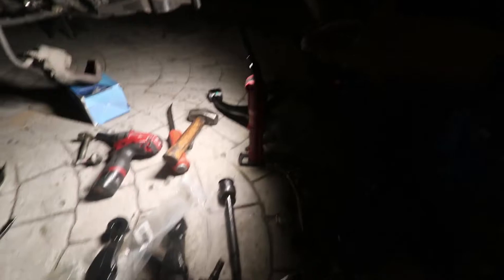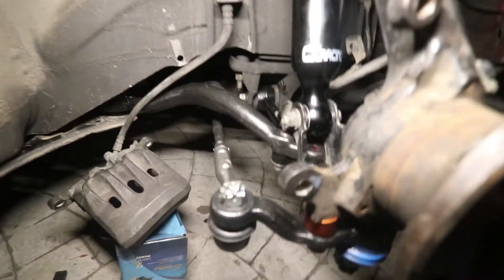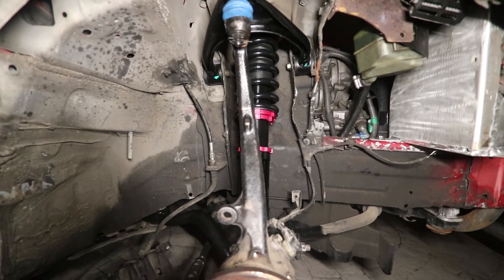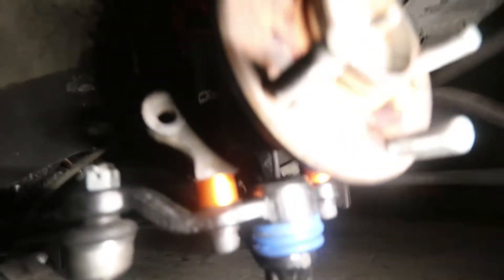As you guys can see, everything is out on this side. I've got the new control arm here, getting rid of the old one, and new arms and new coilover going back in - really excited. We got to get moving, it's already dark out. I've been hard at work and we've got everything installed on this side - coilovers in, control arms, tie rods, everything is new on this side. The only other thing I didn't do is the end links. The knuckle spindle I'm not sure if it's slightly bent, so we might replace that, but upper control arm, ball joint, inner and outer tie rod, and spacers are all done.